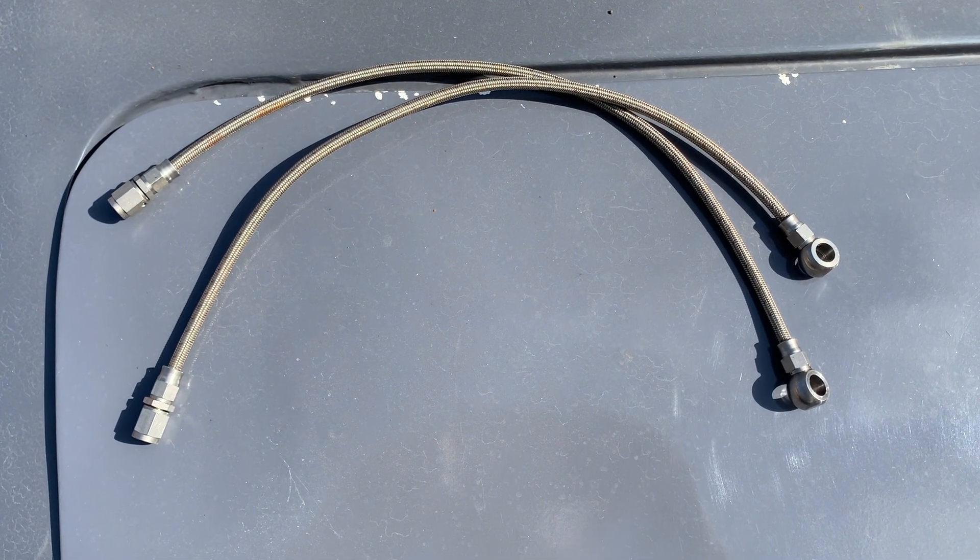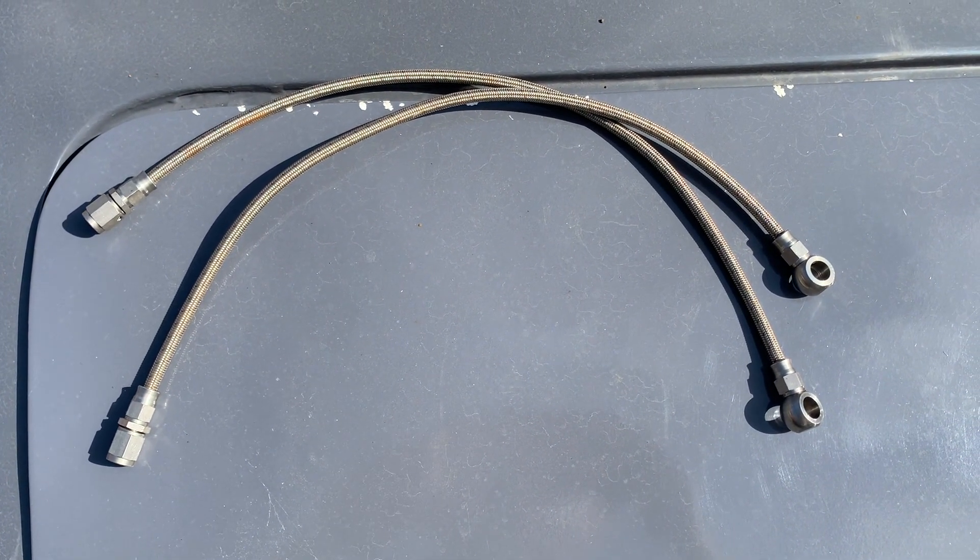Excellent job fitting some custom braided brake lines, so we're nearly done with sorting out the brakes. As expected, some of the hardline flares were bad — that's why I ended up getting Steve to redo some of them ahead of time — but there were a couple that still needed redoing. We've done those. The rears are completely bled, the fronts just need a quick bleed and then we have brakes.